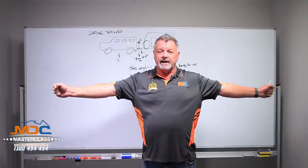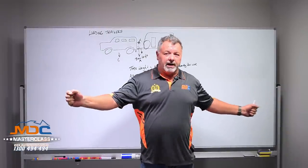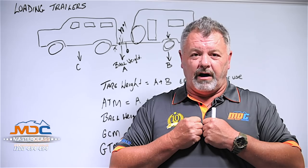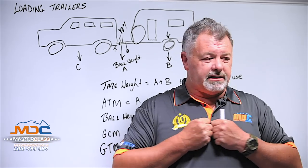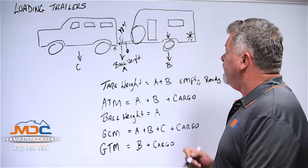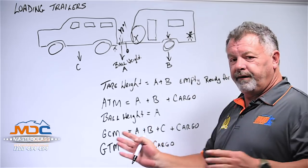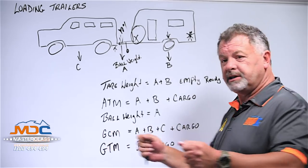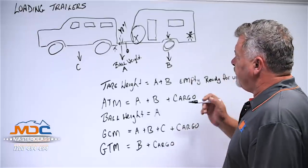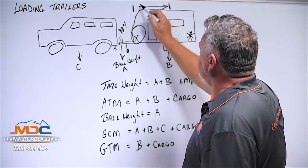Imagine you get two two-litre bottles of milk. Hold them out at arm's length and then spin, then try and stop in a hurry. What's going to happen is there's going to be inertia — the weight of four kilos is going to want to keep spinning you around. But if you hold those in close to your chest and spin, you'll find you'll stop a lot quicker and a lot easier. Same thing will happen with a caravan. So if you load a large amount at the front and at the back, and you get unsettled on the road, you're going to get a pendulum effect. It'll upset the handling and can become dangerous. So where you want to put your load is between those points — that is our best zone.